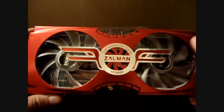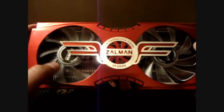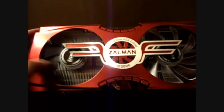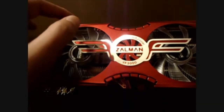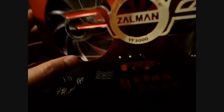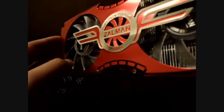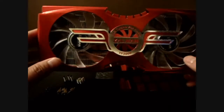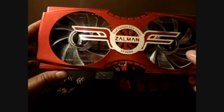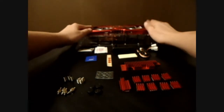You have your free-flowing 92mm fans, and one of them I found was rubbing on something inside. One of the blades was stuck on the upper edge. So that's something you definitely have to check before you put power into this, because you don't want that striking something and breaking apart — plus you'll lose half the functionality of the heat sink.